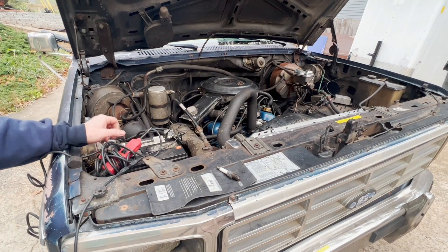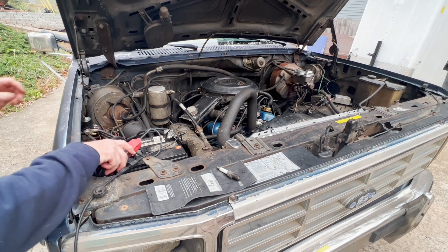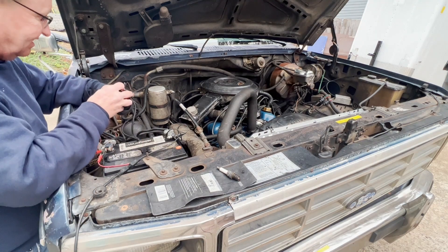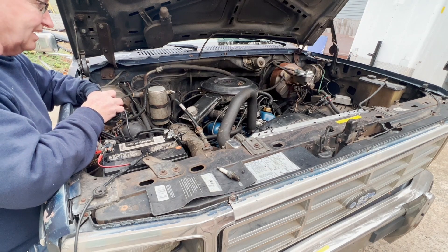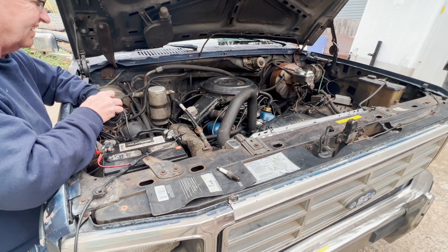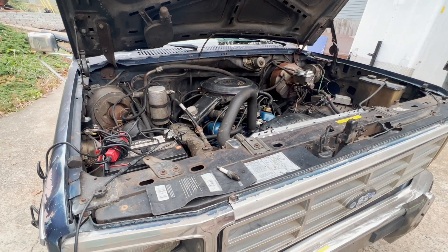See that? You can hear it kick, but we'll do that again. You can hear it kick — it's trying. See, it started and died out. So I'm going to switch it — turn the key off since it's hot — and switch over to the good coil, and we should see an instant difference.